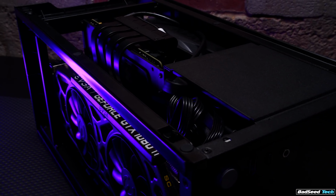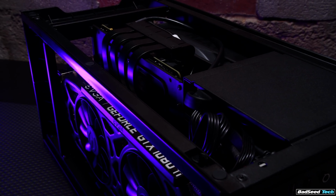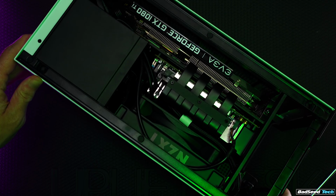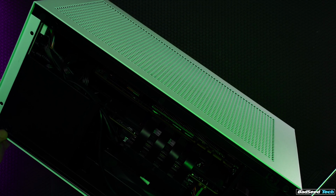You could potentially put together an extremely powerful rig in this case with the right component selection. Looking at you, 3950X. Only downside is the overall volume level, mostly dictated by your GPU, because instead of being completely in a case or behind any kind of sound dampening, you basically have the fan sharing a very vented exterior wall. This is true of a lot of ITX builds, so that's the trade-off. Real world, we're talking about 8 or 9 dB increase from idle to fully maxed out.